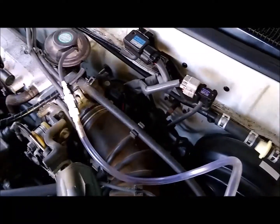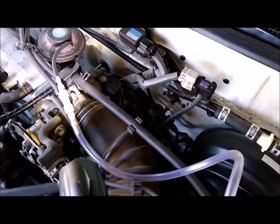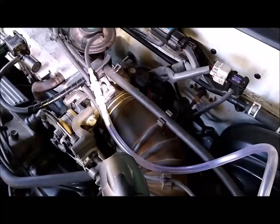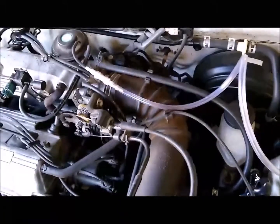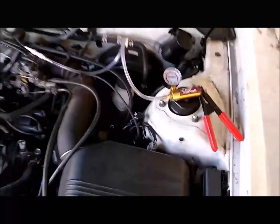For cleaning, I just used carb cleaner — not throttle body cleaner — and let it soak a little bit. For the throttle body, I left it on; just take the air hose off and you can clean it in place. I tried spraying Chem Tool B12 into those holes, but it was when I used the air compressor that I discovered the port was plugged. While using the air compressor, work the throttle and you can hear air passing through. Now I need to go find a better T-adapter so I can troubleshoot further.